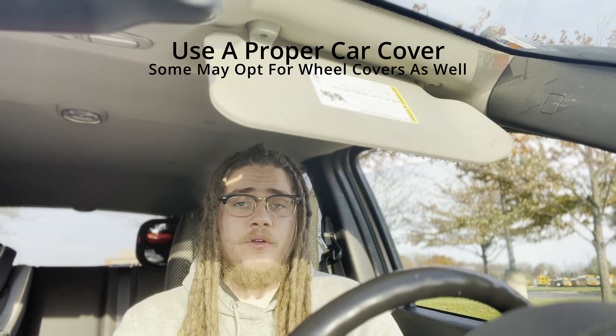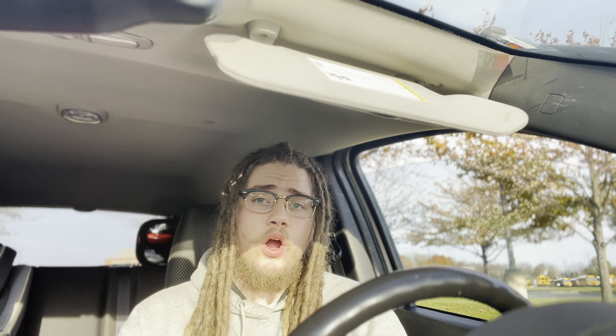If you have leather anywhere in the vehicle, hit it with a leather protectant and cleaner — most are all-in-one solutions. The change in temperature while the vehicle sits in storage can cause the leather to crack. You don't want to come back in four months and find a crack across your driver's seat. Spray down the seats, let it set, wipe it in and off — cover the steering wheel, shift knob, and every seat so you're not upset with cracks next season.